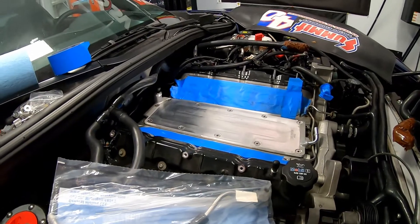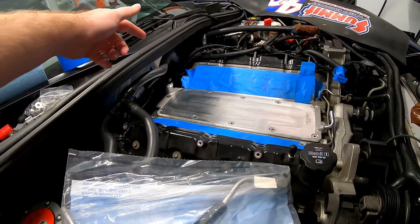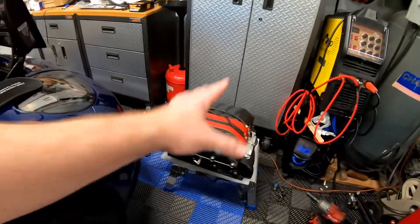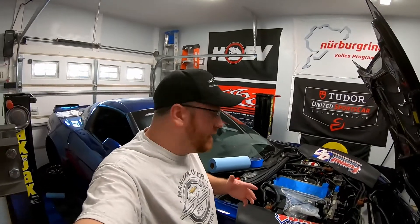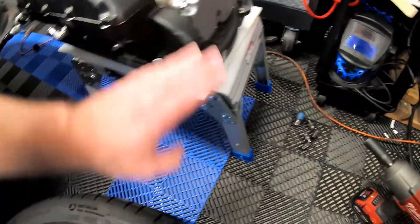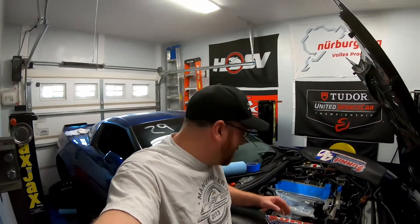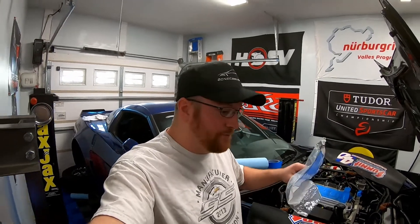Now if we had an LS3 and didn't have a supercharger sitting on top, there are actually steam port kits you can buy — kits that plug into the front and go underneath the intake manifold and connect to the front, or they connect to the rear and go over the driver's side or passenger side depending on which kit you get, tying into your factory steam port vents. Unfortunately we have this big lump of aluminum with some blower rotors inside of it, and that's going to prevent us from using any of the bolt-on aftermarket kits. There are LSA kits and LS9 kits that would work in those applications, but because we've got this LS9 supercharger and its rear intake port overhangs the back by like a good quarter inch, we may have to modify this even more by grinding down one of the corners — we'll find out very shortly.